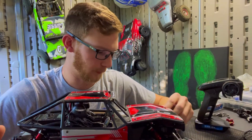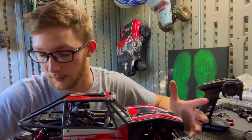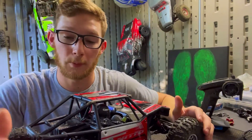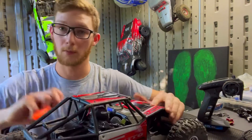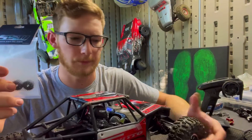I didn't want to go too crazy with it. Now if I do want more, I can either order another set, or I can put in a ring and pinion that has more overdrive — that will add more overdrive — or I can get some underdrive portal rear gears, and that will equal things out to get more overdrive that way.